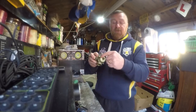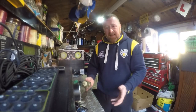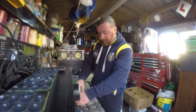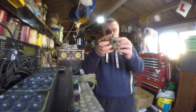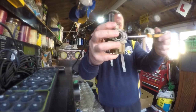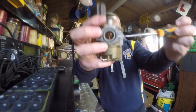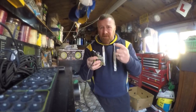Take the screw out, clean it all up, don't lose the bits. Put a sheet down and do it on a sideboard. That is your idle - the top one's your idle. When you look through there's a screw there. When people adjust the idle - you can see it slowly going out. What you mustn't do is bend the needle where it's touching, because you get all sorts of problems with that. So try not to do that when you're adjusting the idle.